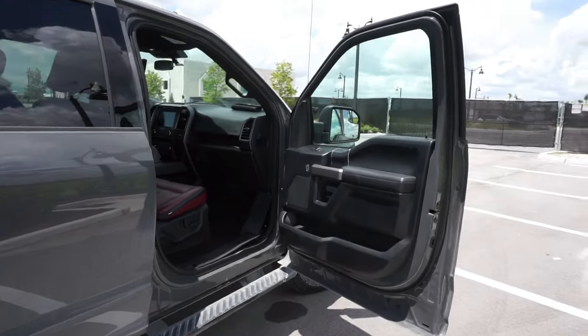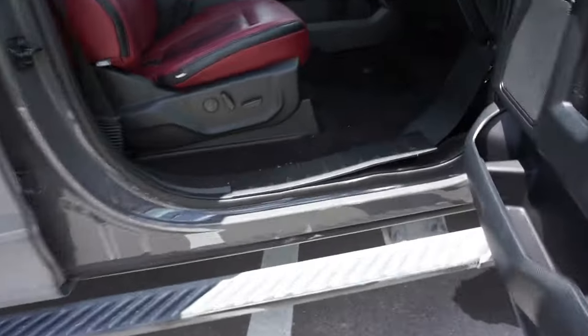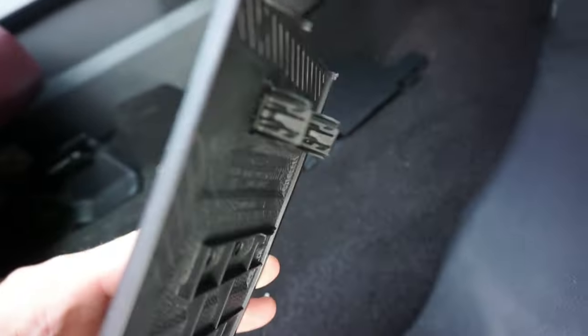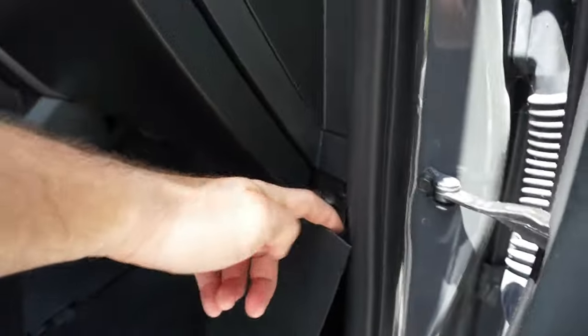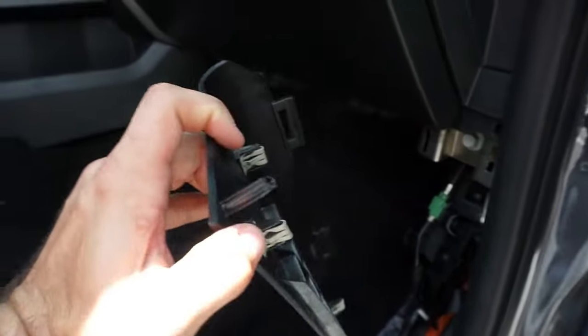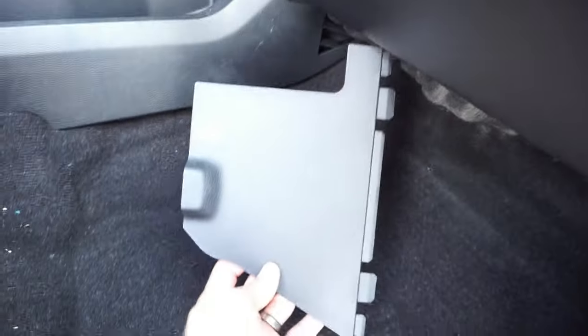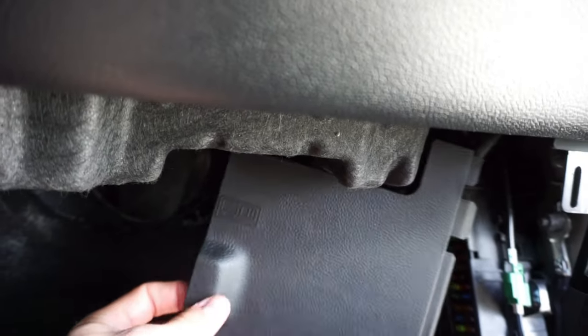And if all else fails, come over to the front passenger side door. Come right here, grab on this little panel, pull up — some little plastic tab clip things will pop up, which will allow you to pull this guy off. Before you pull this plastic panel off, pull the one that's behind it in the very back. It looks just like this — there's a nice little part for your finger, you can just pop it off just like so.